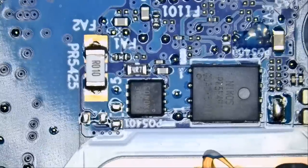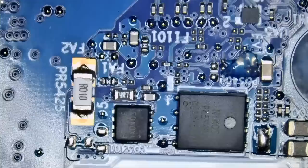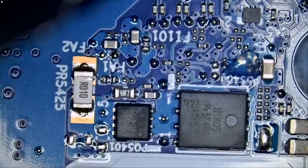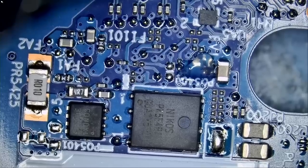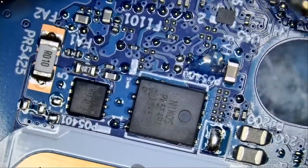You may be asking yourself what caused that fuse to blow. The customer likely did some modifications to the laptop without disconnecting the battery first, and that's how that fuse blew. I do see a Samsung SSD drive installed on that laptop, so the customer likely upgraded his M.2 SSD drive without disconnecting the battery first — and that can cause issues with the backlight circuit. In this case, a fuse blew.